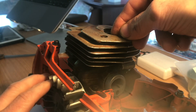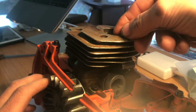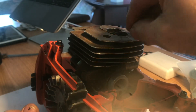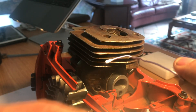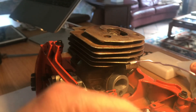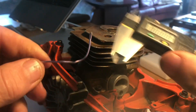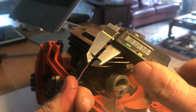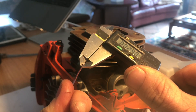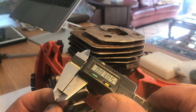Turn the crank with the piston up to the top, then just force it around a little bit more. There we are — you can see how the solder is crushed there. We're looking for the measurement right at the end. With the vernier calipers: 35... 29... 28... 28.5... 29... 29 to 30. So that's plenty.